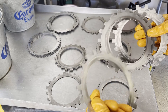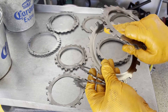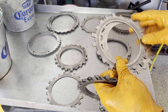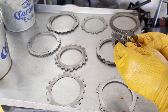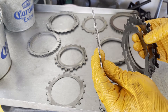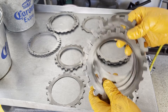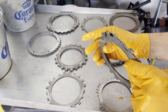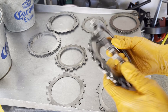However, if you look at these, they're pretty worn out. You can see wear patterns here. Some of the plates are scored, and in addition to that, some of them are actually warped a little bit. It's probably not going to be obvious on camera, but if you had them in your hands, you'd readily be able to tell that the steels are not flat.